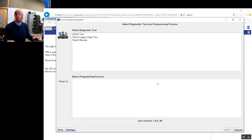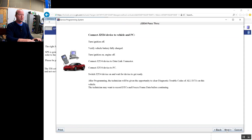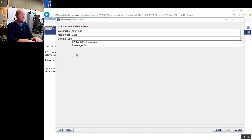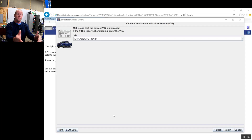Now we are connecting from the computer to the car. We're going to follow the instructions — J2534 tool. We're going to replace and program an ECU since we are replacing the airbag module in this car. It's going to give us a list of instructions — connect the J2534 device to the PC and make sure everything is lit up. I do have all my lights on. We're going to select the vehicle: this is a Chevy 2015 passenger car Volt. It's going to ask us what J-Box we are using. Any J-Box registered to your tool or PC will show up. I have the JVCI and I'm going to click Continue. It is now communicating with the car to pull the VIN — if it pulls the VIN, we know the car is talking to the J-Box and we have our complete connection.